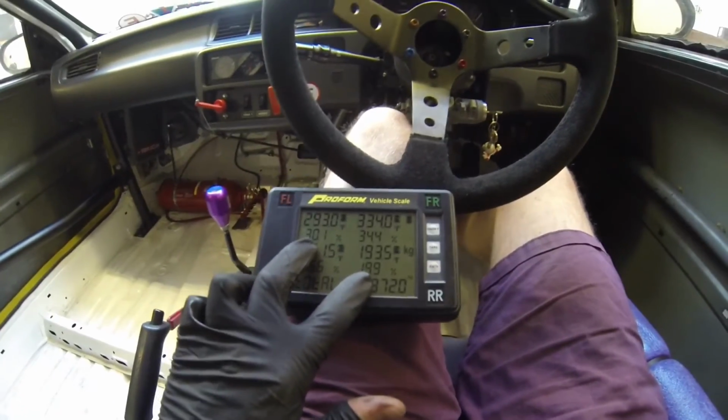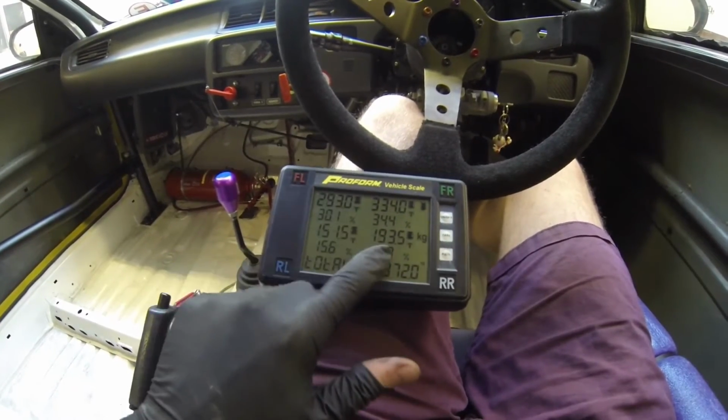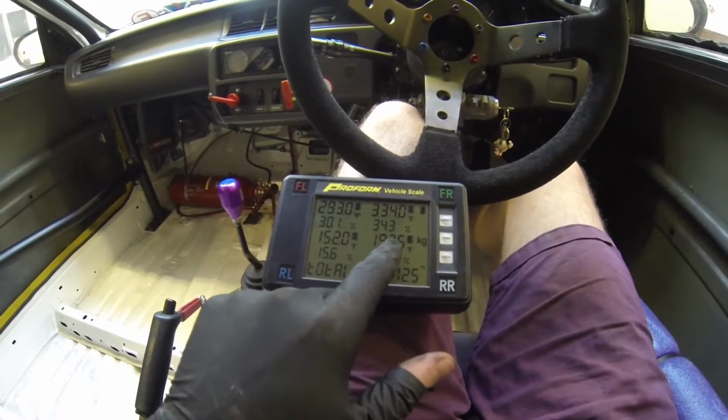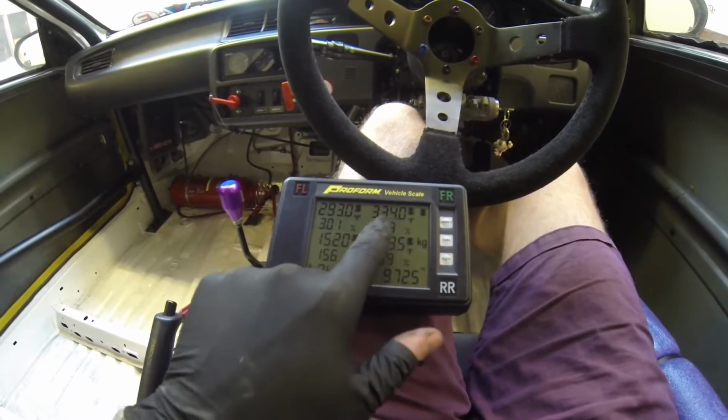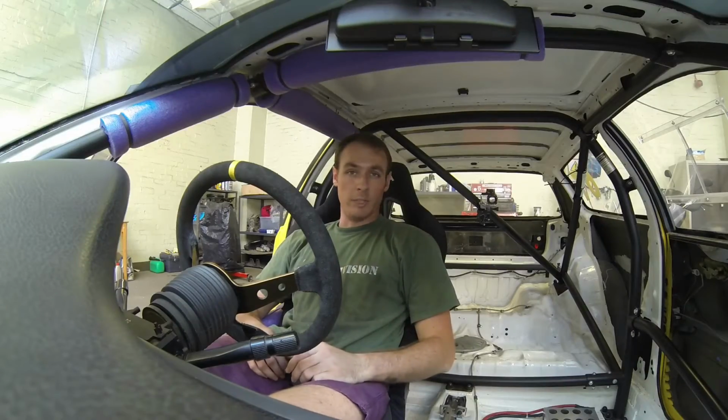So obviously, it doesn't take a genius to work out. 30.1 plus 19.9 is 50% across that way. 15.6 and 34.4 changes just as I touch it. Across that way is 50%. So that's your cross weight at 50%. So we're even that way and that way. Okay, that's me done for today.